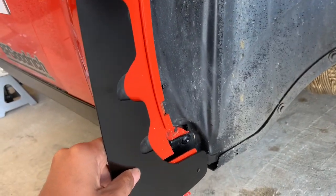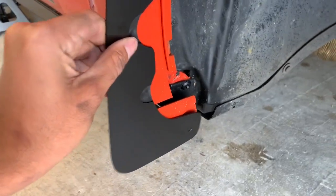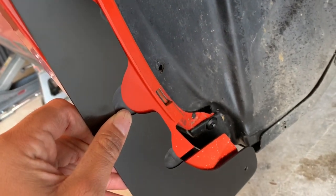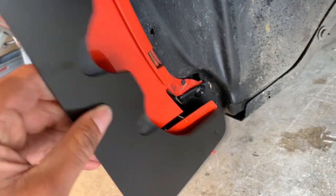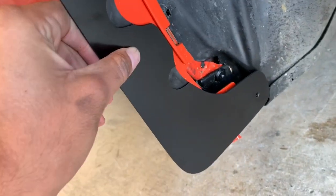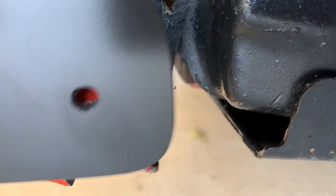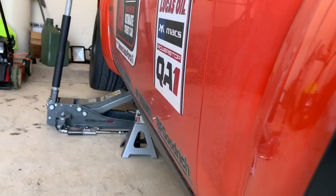Because they are aftermarket flares, even if it were to line up on the edge right here, we're going to be able to use a clip to hold it in place. Actually, what I'm going to do is drill some holes and use some plastic rivets. I'm thinking of using this hole and lining it up with that hole right there, holding it in place with a plastic rivet or metal rivet, then drilling the other holes over here and turning it in slightly. That's what I'm going to do - I'll get started and show you guys the final product.